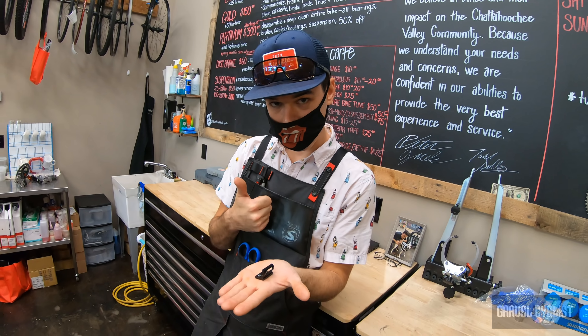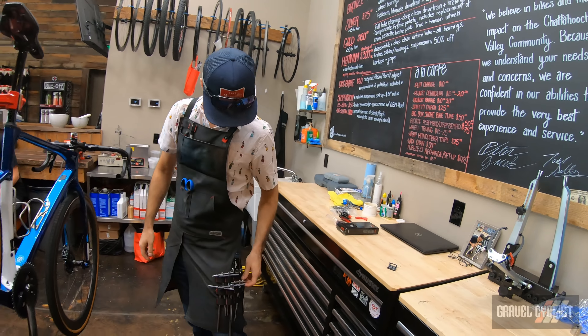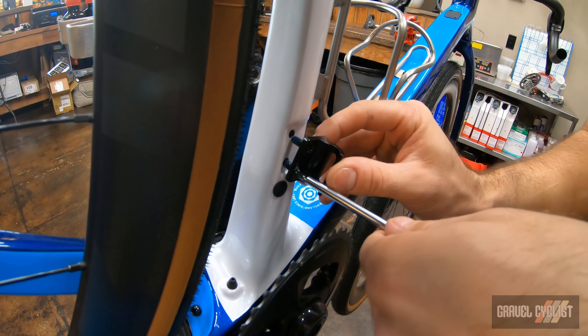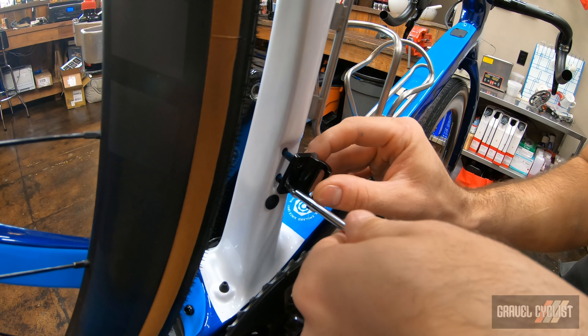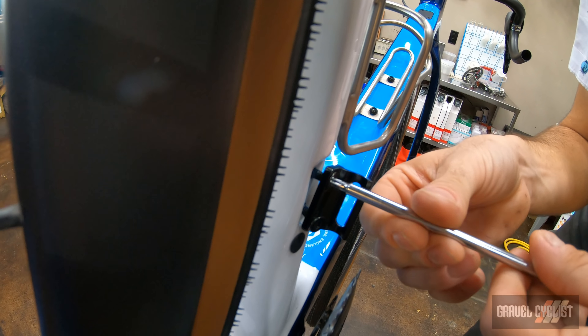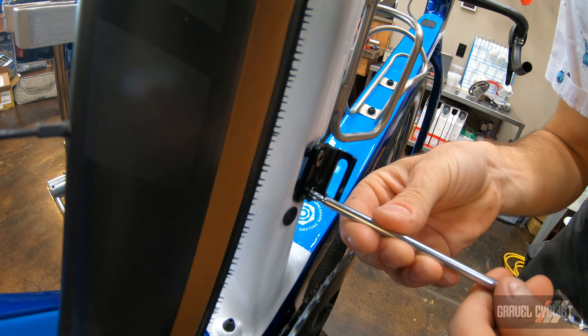We are at Frick Out Bikes. There is a front derailleur hanger which solves that dilemma, so we're going to continue with the build. It's only been a little while but patience is a virtue. We've got some Loctite on these bolts — we don't want this front derailleur coming loose ever. It could ruin your day on a nice long gravel road.